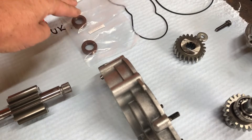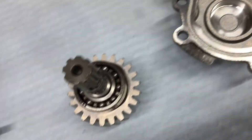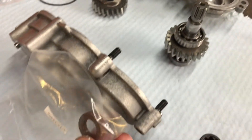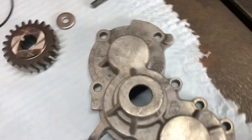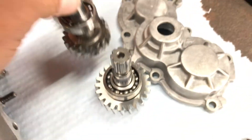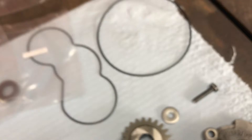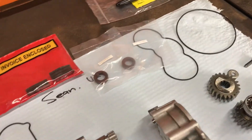The two seals use Viton, which is why they're brown in colour - so don't replace those two seals with standard ones. One runs in the very front case here, down in that bore behind the bearing. The other seal runs down in this bore here, which seals the auxiliary shaft that goes back to drive the air conditioner or water pump. On Sean's we've replaced the four ball bearings, which are all the same part number, and the O-rings we replace with high quality regular O-rings - they don't have to be moulded to shape. They work perfectly fine; we use them in all the race cars and never have a drama.